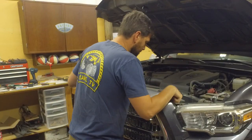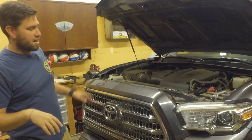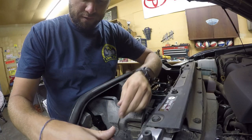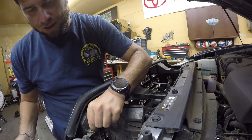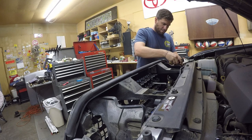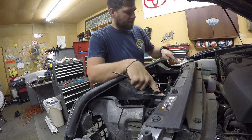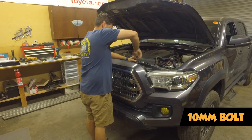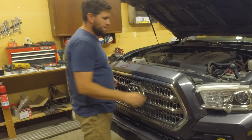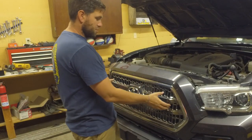Now what we've got to do is pull the tab right here — two bolts and the tab on the other side — and we can yank this out. To pop the clip off up here in the front, you just take a screwdriver, pry it underneath, and pop that up. These things come out nice and easy. You've got to do that on both sides. Now we need to pull the 10 millimeter bolt — there's one here and one over here. Now it's as easy as pulling it straight off; just give it a solid yank and it should come off.